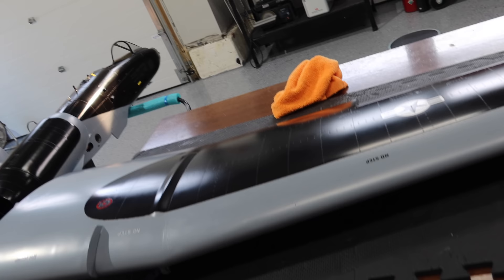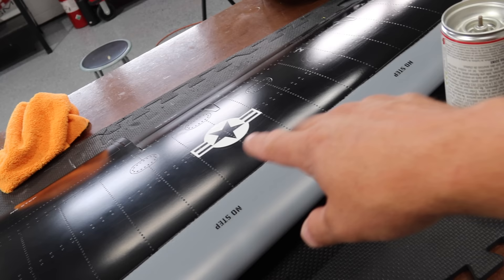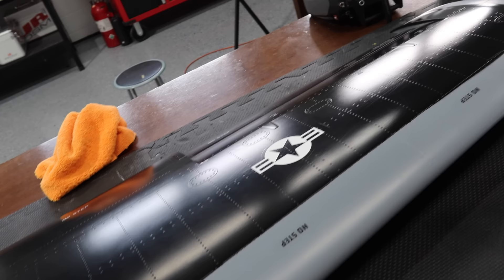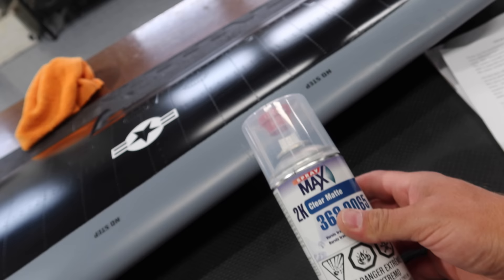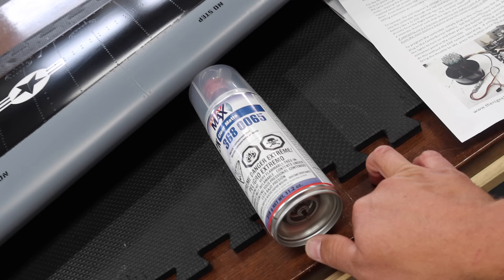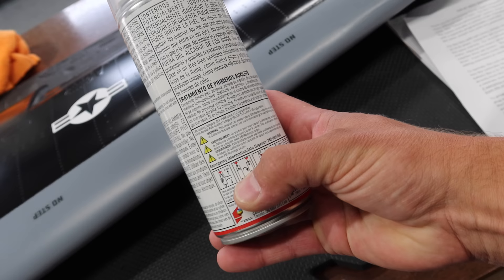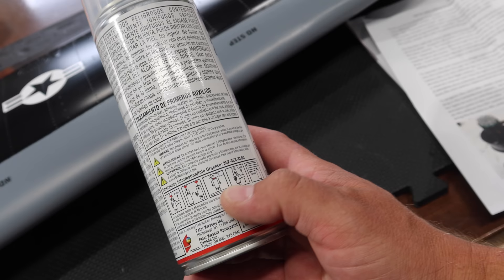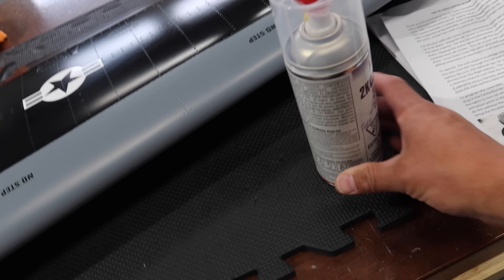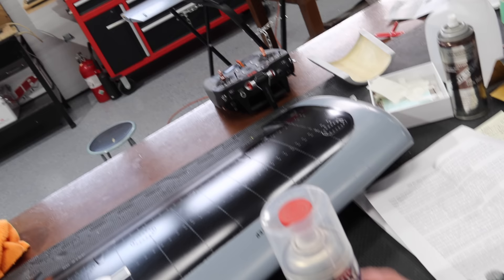It is clear coat day today. We've got a bunch of parts ready to clear coat. I've done the nomenclature on one of the wings, and we've got both verticals and the horizontal — the elevators and both rudders — ready to go as well. Getting my 2K material ready. If you've never used this stuff before, basically it's two parts. Once you puncture the bottom, you've only got about 24 hours, but you should use it right away. You shake it for two minutes, take the little red cap, put it on the bottom, puncture it, then shake it again for two minutes, and then you use it. I won't show you the clear coat process because it's very similar to the painting process.